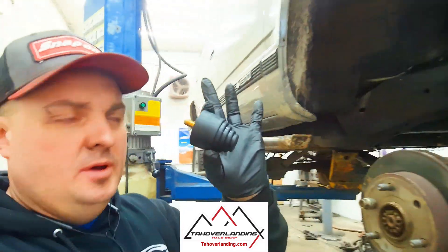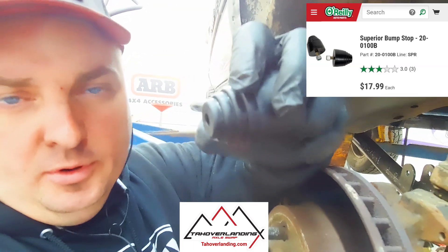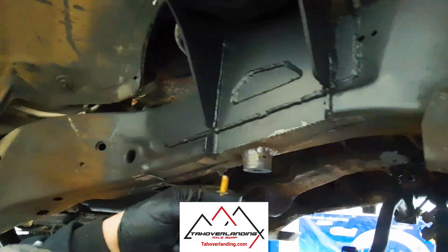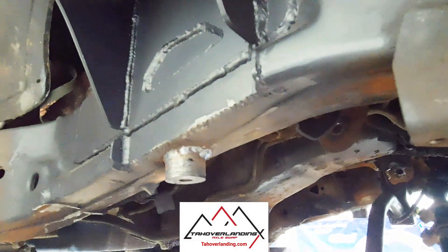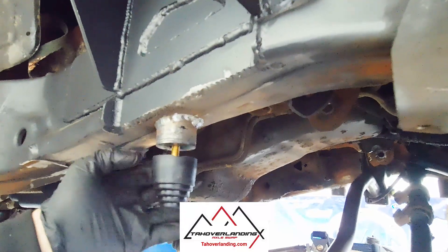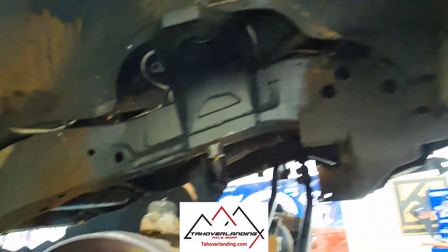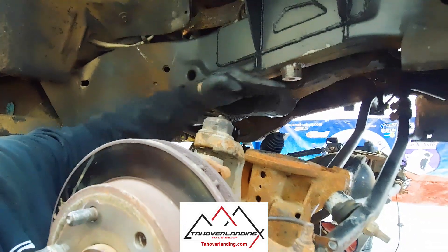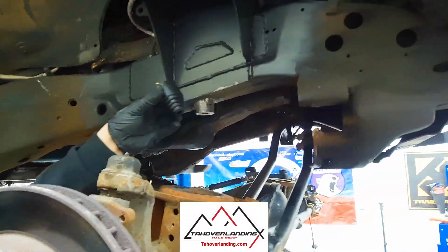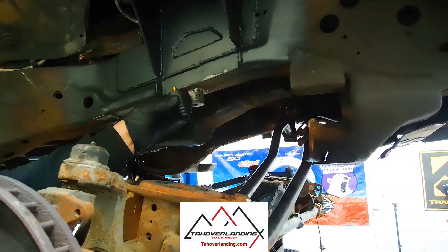Now it's time to talk bump stops. The ones I like to use have little steps on them — so if you ever need to lower them, you can trim off that rubber incrementally. They thread in, so you can also stack fender washers on the back to drop them and fine-tune. I took some pieces of tubing with a nut welded on the inside, thread that on, and the bump stops install. Notice they're welded on at a slope so they're level and contact square — because at the angle of the frame they might put stress on the stud. I try to make them square to the travel of the suspension rather than square to the slope of the frame.